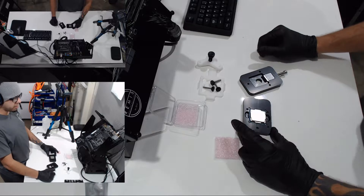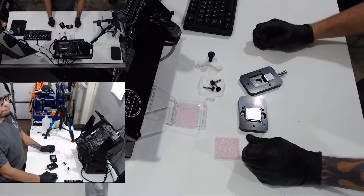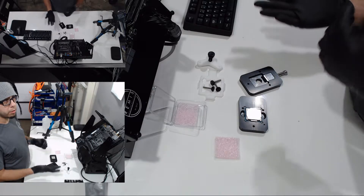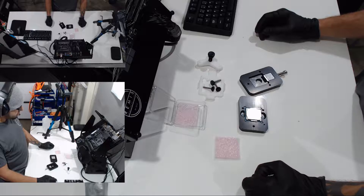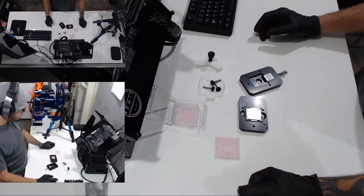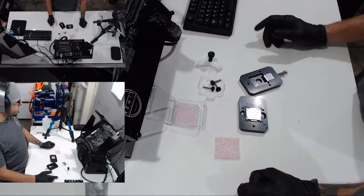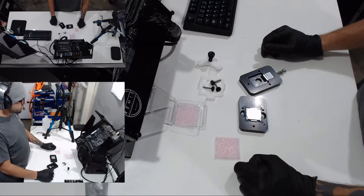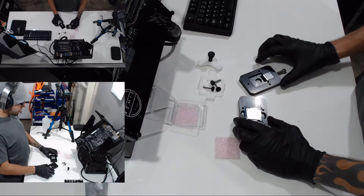This is a process I do offer on client builds — I just started offering it not too long ago, and I even have a service for random clients who want this done because it can really shave off up to 20 degrees Celsius. My 7700K saw a 12 degree drop in temperature; this i3 only saw a 5 degree drop, but I think it's mostly because it's used with the 212 Evo cooler which is probably at its limit.